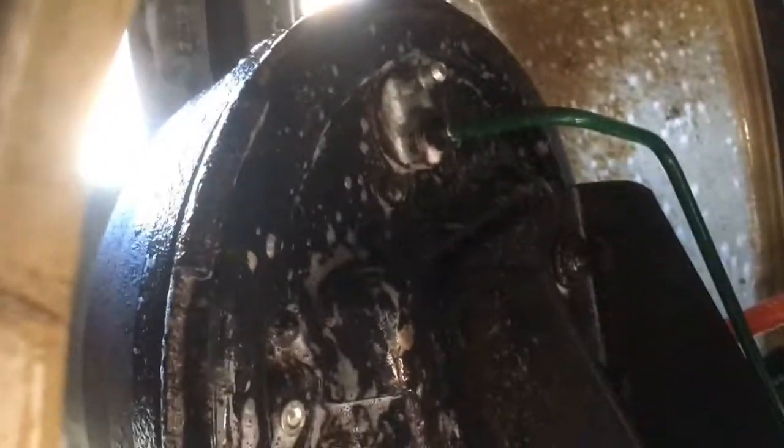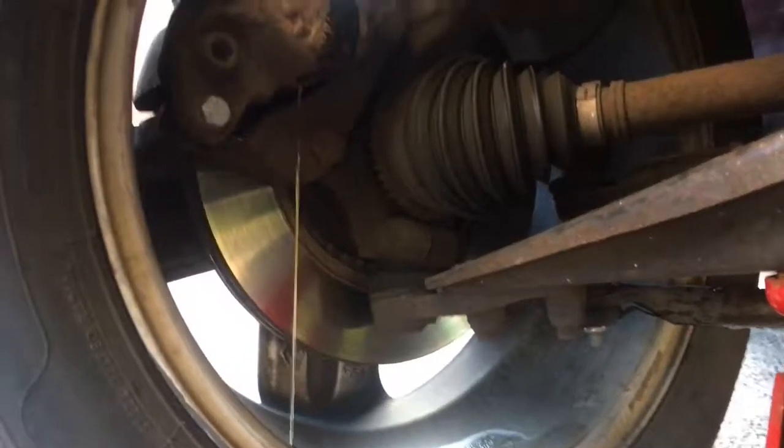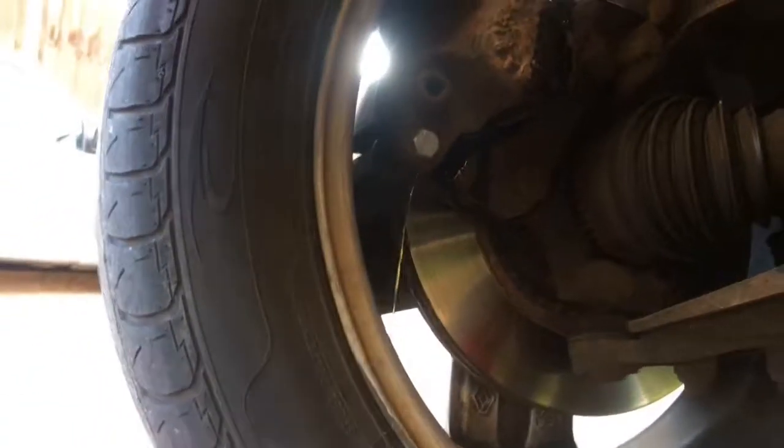With the pressure bleeder back up to 20 psi, it's fairly clear that our nipple's not leaking. Go ahead, put our rubber dust boot back on and move on. Offside rear wheel, bleeding, no issues whatsoever. Just cracking the last bleed nipple off. Done all the other 3.